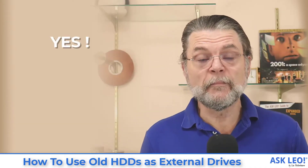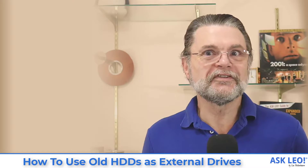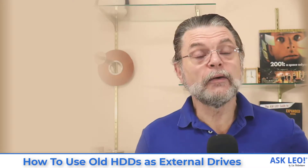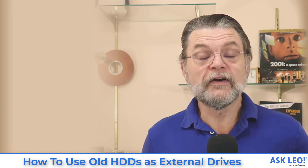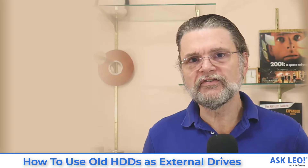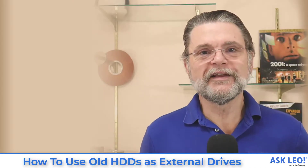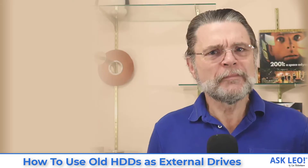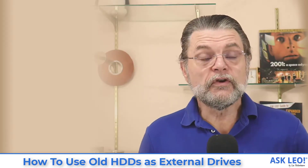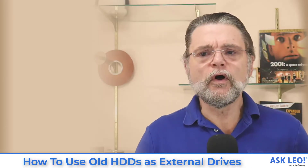Yes, you can. In fact, it's something that I do a lot of myself, especially as drives — the drives don't get smaller, but our expectations get bigger. So the drive that was huge five years ago is now only marginally big. What happens in my house, at least, is that as I upgrade my drives, I take the old drives and very often put them into external drive enclosures, and then attach them either to the same machine or a different machine to use them as external drives — for backup storage, archive storage, or whatever kind of storage makes sense. Quite often they end up attached to an old machine down in my basement that has something like five or six different old drives connected to it, both internal and external. It's a great way to use old drives from old computers that really aren't serving you well anymore.